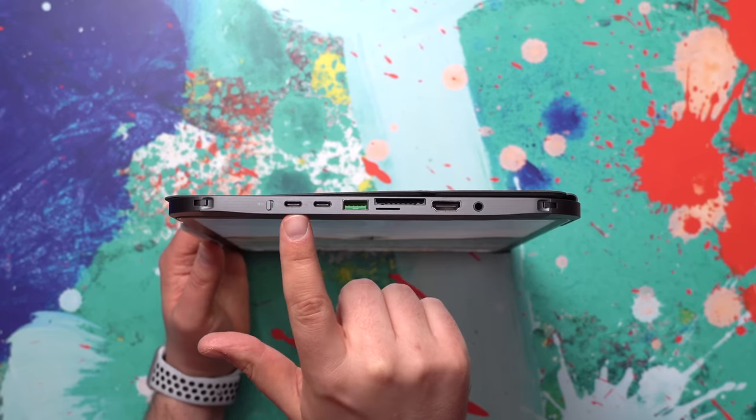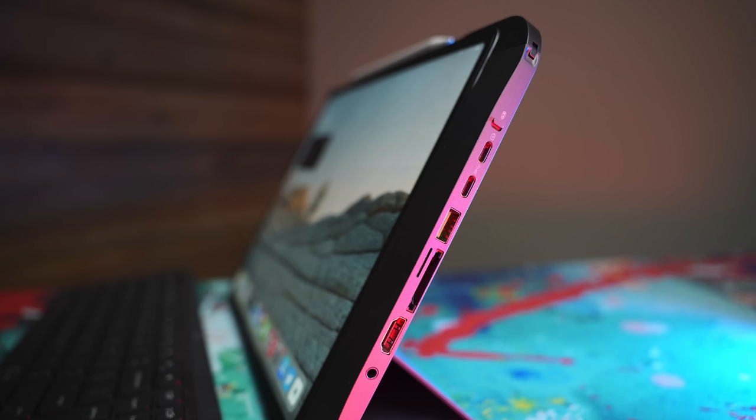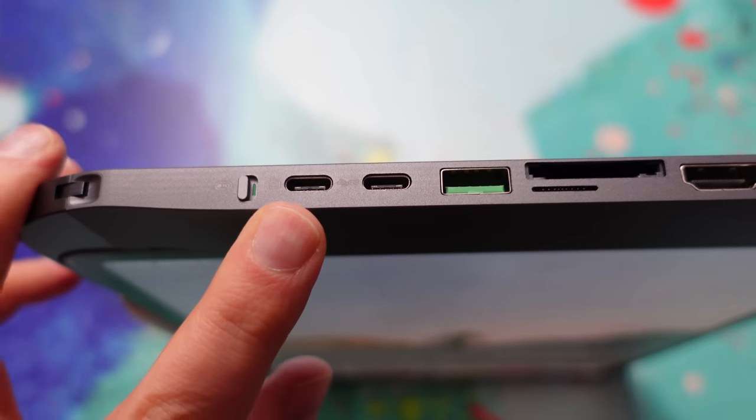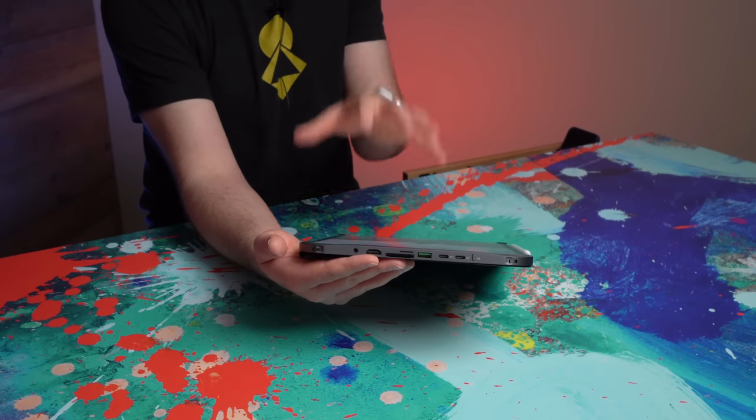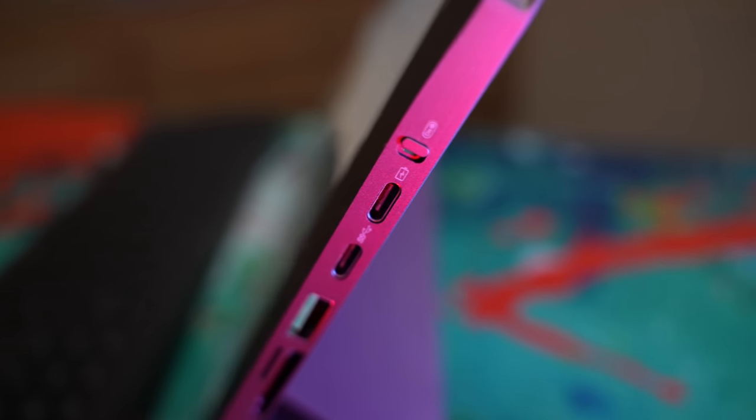What we've got here are two USB-C ports, a USB-A, an SD card reader, another card reader, an HDMI port, and a headphone jack. Before you throw a party about two USB-C ports, let me explain something. I've been saying forever that I wish Apple would add two USB-C ports on the iPad Pro — maybe one on each side. Apple gave us the Magic Keyboard and it had an extra one, but that's only for charging. The hub portion here has to plug into the iPad's own USB-C, so that one is taken, it's gone. Of these two ports, one is for charging only and the other is for data only. So yes, there's two, but you're not really getting an extra one to use how you might wish you could, unfortunately.